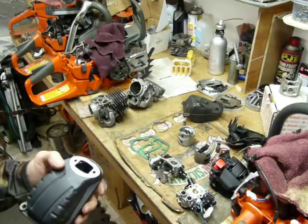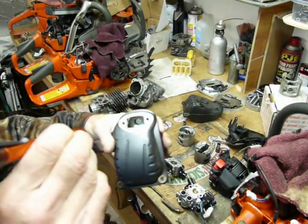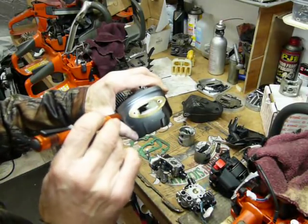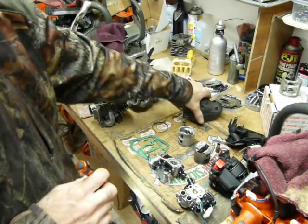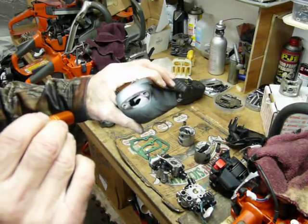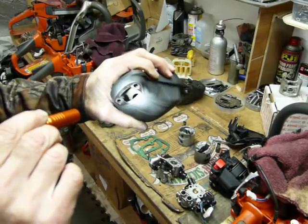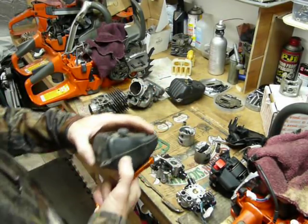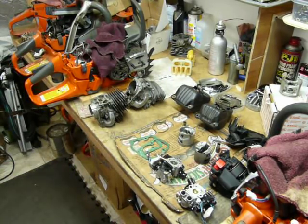If we look at one thing that I thought was pretty interesting in these mufflers, we can see there's a hole right off the bat that goes into the main cavity, but then the rest of it has to travel down in the tube. There's actually one small hole in the 562 right there. If we look in the 550, same kind of hole concept, but there's actually 2 bigger holes. They're actually bigger than the lower single hole in the 562 that lets that exhaust escape a little bit quicker. Thought that was interesting. A little more narrow, about 10 millimeters or so.